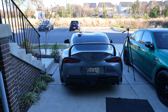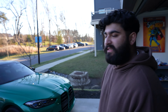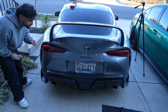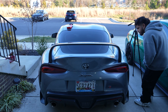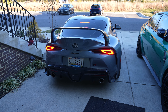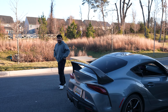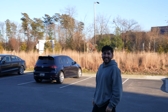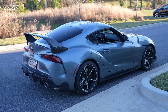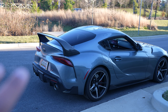We got all the holes drilled to size — I think the size we went up to was 15/64. This is the weather stripping, and it's as simple as taking it right across the edge here. It doesn't need to be perfect because it is going to get smushed. I'm going to keep it about a millimeter toward the inside so it doesn't show on the outside. Just work your way around the entire base of the spoiler, go all the way to the edge, and cut off any excess. It matches up pretty well with the trunk line.